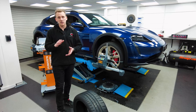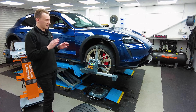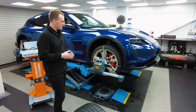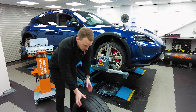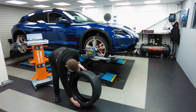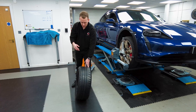You have a thing called camber and caster. I'll give you a little breakdown. Effectively, camber and caster are two of the main areas which cause some of these cars to wear through their tires. These cars have quite a lot of negative camber, which effectively means the tires lean inwards — this is set to standard here so there's no camber on it — and that effectively lifts up the outer edge of the tire, so the inside of the tire is where a lot of the contact patch is. This is a bit extreme, but I'm just doing that to showcase to you.